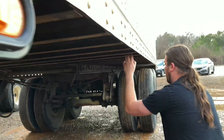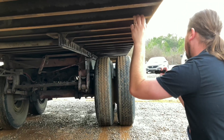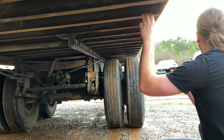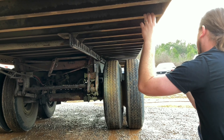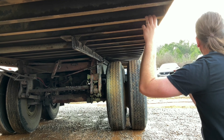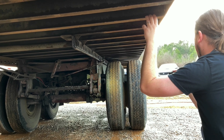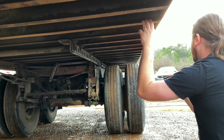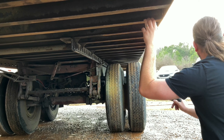Checking my suspension: my spring mounts are securely mounted with no broken, loose, or missing parts — both front and back mounts. My springs are not broken, missing, or misaligned; a quarter or more missing would put my vehicle out of commission. My u-bolts are securely tightened and not broken or missing. I have a torsion bar that is securely mounted and not damaged.